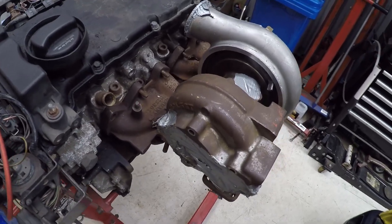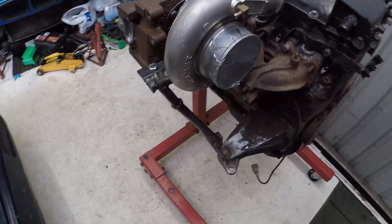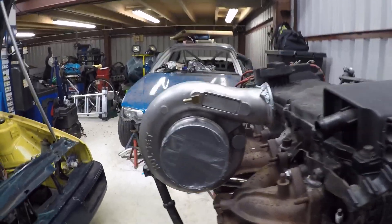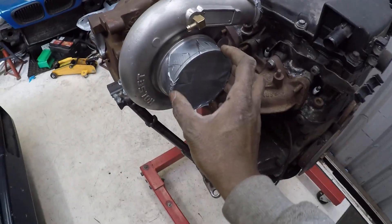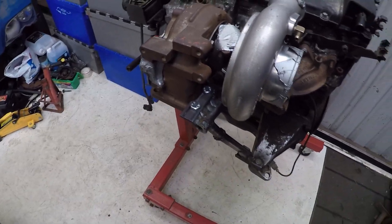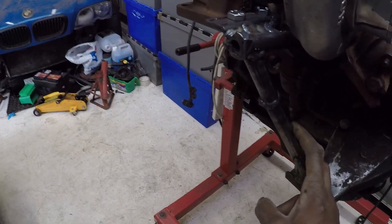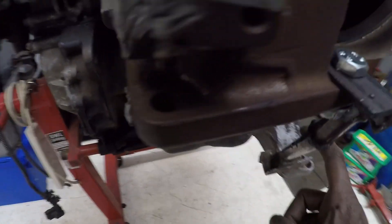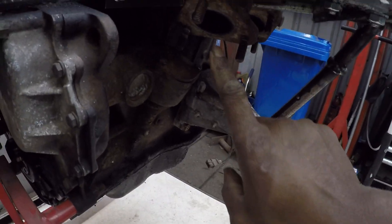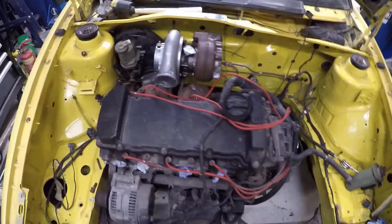I'm making progress — this is where I think the turbo needs to be. I still need to test it in the car to make sure it's not hitting anything, but I think it's okay. It's low enough so the bonnet should still shut fine. I just need to make sure there's enough room past the servo and master cylinder and it's not hitting the bulkhead or the clutch cylinders. I've made this little jig to hold it in place, and I can use it to make the link pipe coming out of these two ports, spinning up and into the flange.